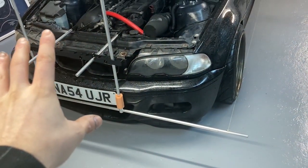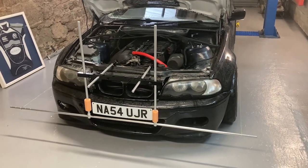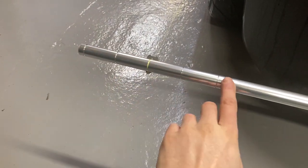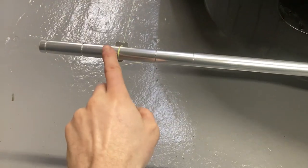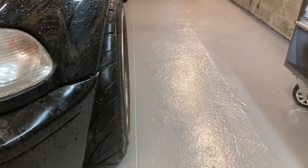So we've got — I think this is a BG string kit. It's about 300 pounds online; I'll link it in the description. I've used it maybe seven or eight times now and can't fault it at all. It's quite simple — you've got all these poles to attach on. It doesn't really matter about the pole being in the middle because it's all about these notches. Wherever you put the string that goes down the side of the car, it needs to be the same front to rear. If I have it on this notch, I have to have it on that notch over there and the same over here. I'm on the third notch to get it quite close to the wheel so I can measure — you can have it further out, but it's just easier when it's closer to the wheel.